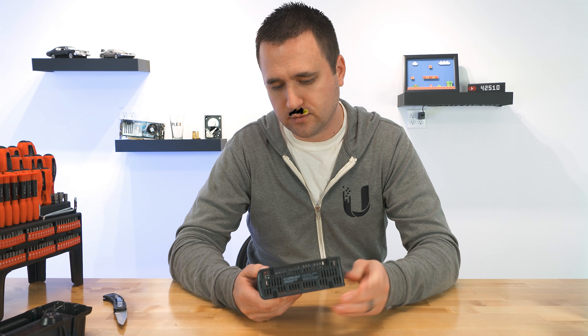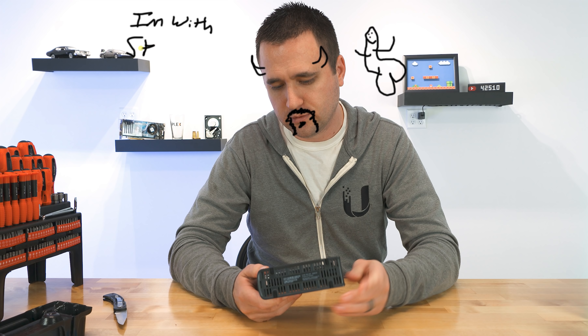Editing Jason here — looks like after doing a little bit of research online, this is still technically a Western Digital Red drive, it just has a different label. These are referenced as white label drives. During my research, I found that some people had issues using this drive with normal SATA power cables — something about a 3.3V reset voltage pin that was enabled on this drive that's not on normal drives. If this is true, you may need some additional modifications to your power cables in order to get the drive to spin up. As another side note, I paid $129 for this drive, not $139.